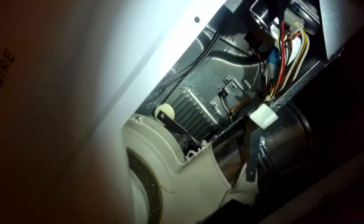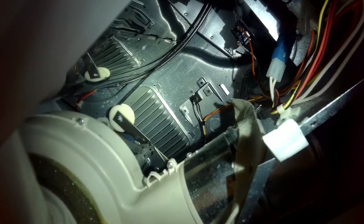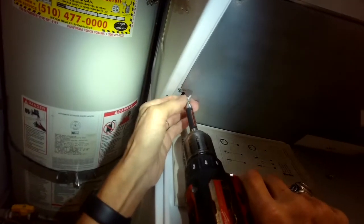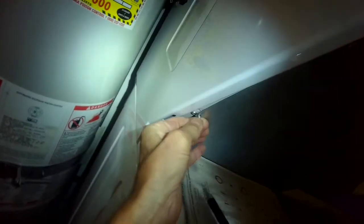There's a little hatch in the back that you can remove that makes it really easy to put the belt back on. If you have to do it from the front, you can in this little access space. Just reach in with both arms, pull the idler wheel to your right, then reach down and push it onto the little motor pulley.